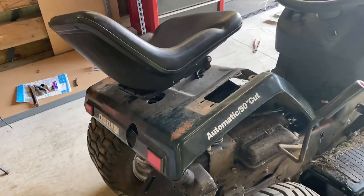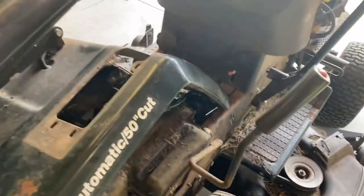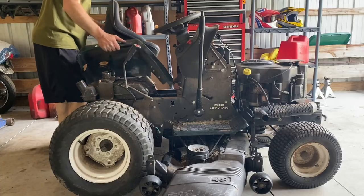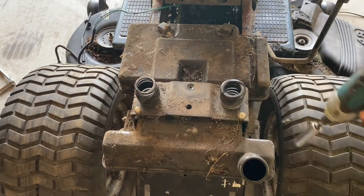To remove the back portion of the seat and the rear fender, there are two bolts here and one bolt there — that disconnects it. You have three bolts on both sides, then you have to take off this assembly with a few bolts so you can slip it over the transmission. On the seat, you have to disconnect the safety switch and pull that cable out. Then there are two bolts to take the rear suspension piece off.